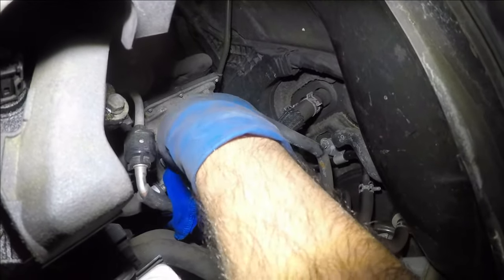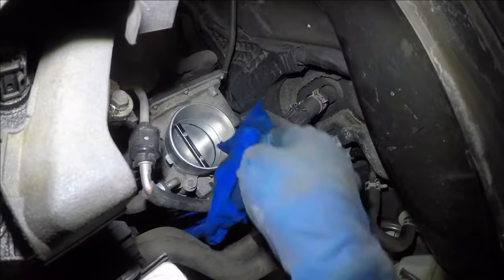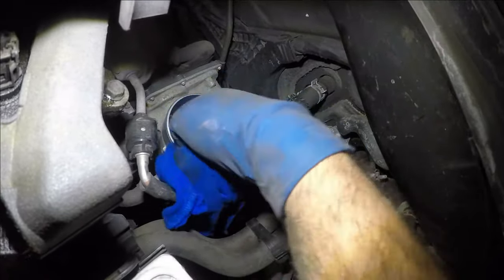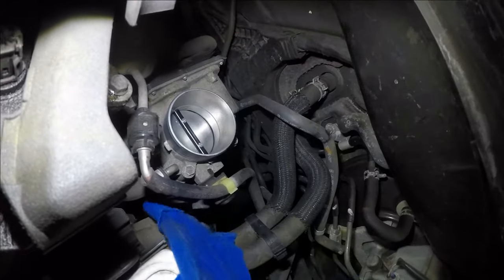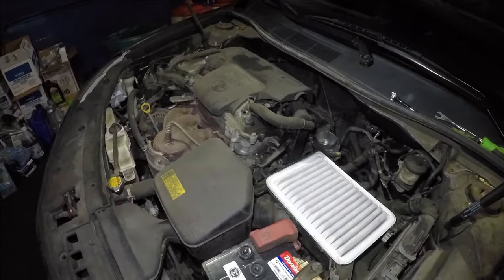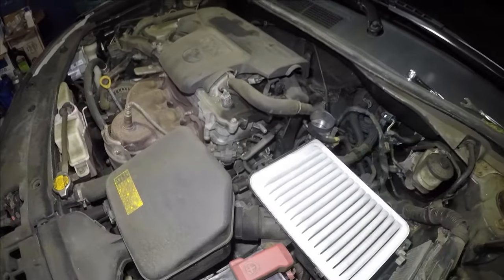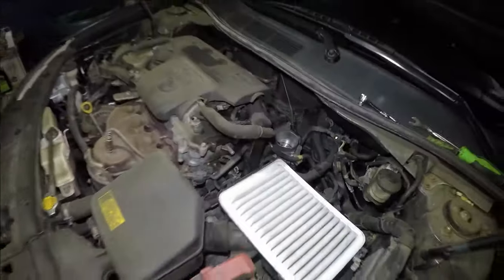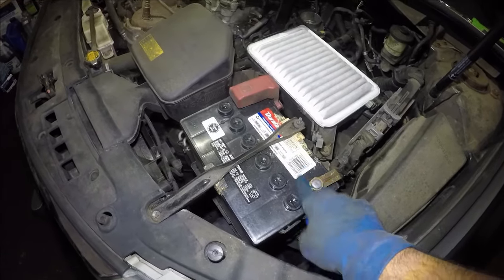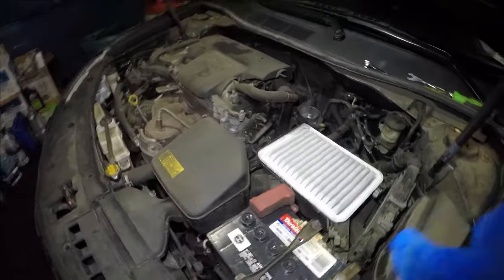Let it go. Once you're all done, I even like to get the little edge of this. You can let go the throttle and just clean the edge of the plate. This is gonna resolve a lot — you might not have 100% back to normal, but I have never had an issue after I did this. Thank you for watching, don't forget to subscribe, share and like. Make sure you put everything back together. If you have check engine codes for this, just reset it — do not remove the battery terminals, you'll mess up the idle that way.